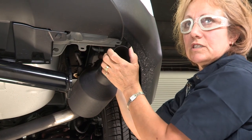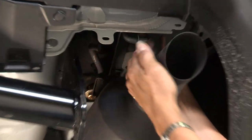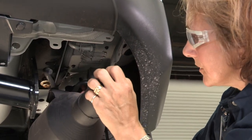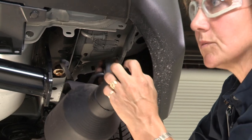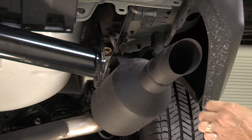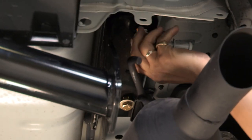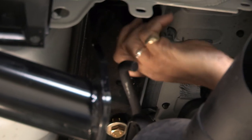We're having trouble with this one bolt — there's a bracket on this muffler. It is an option to lower the muffler, so we're going to go ahead and do that. There's a grommet that you pull off. This one's so easy you can just take it right off, and now it's more out of the way so you can line up your bolt better and slide it right in. It went right in, so it was easier to take it off.